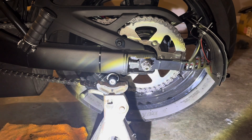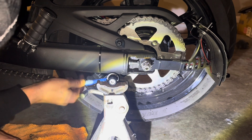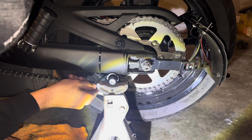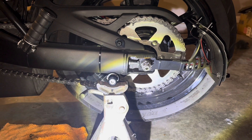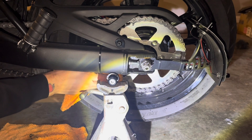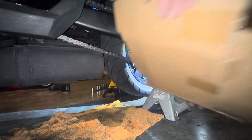If you look at the very top of my sprocket where my chain meets it, you can see the grease and grime buildup, and also grease spackles on the actual sprocket itself. So we're going to go through and clean it tooth by tooth — this goes pretty quick. After we clean all the teeth, we're going to wipe down the surface and make sure the front face and the inner face is clean.